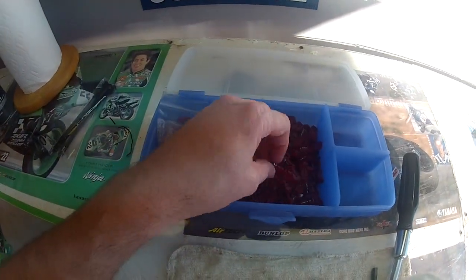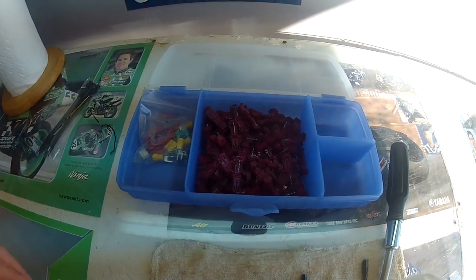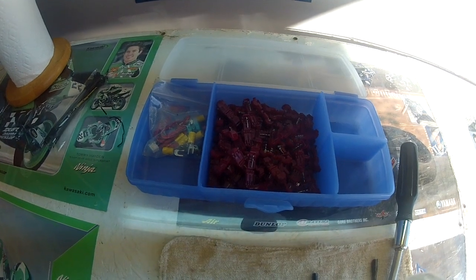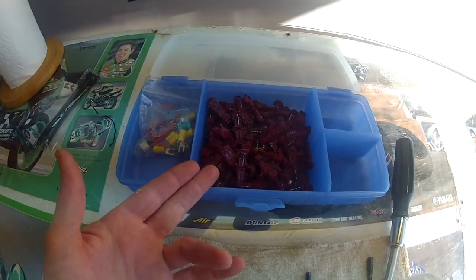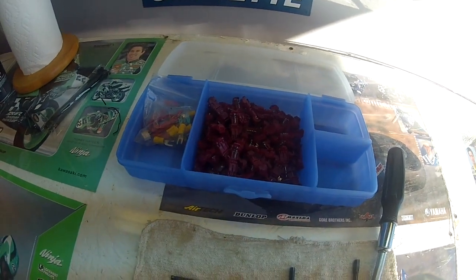This is the wire tap that I used, but if you don't have anything plugged into your cigarette lighter as an accessory on the back of the cigarette lighter, then you don't need the wire tap. The only reason I needed it is because I'd already plugged into that for the signal wire for my amplifier.